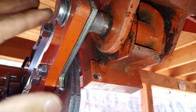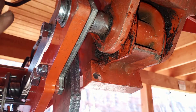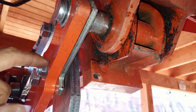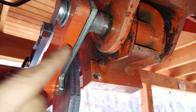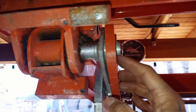The other thing I'm going to do is take this 14mm bolt out to get clearance and put the bushing in there that's missing — I'm assuming it's missing from the factory. This side has not been taken apart; this is how it came from the factory, and there's no free play in here.